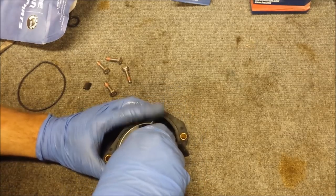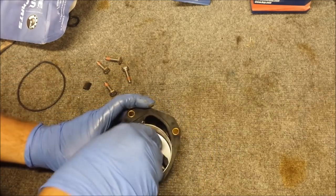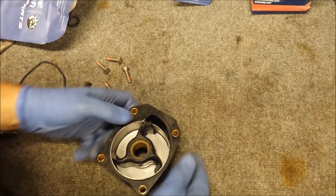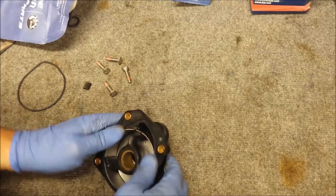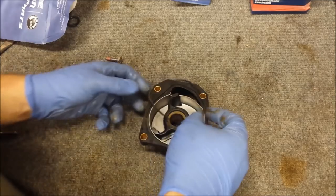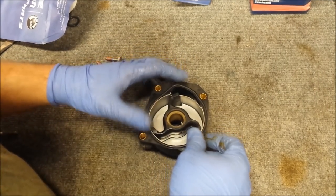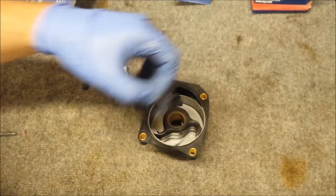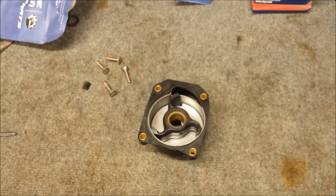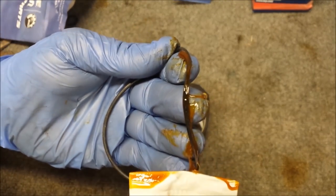This is not easy, by the way. And we got our seal here. I'm going to put some Gasket Sealant M along this seal to hold it in place, and then it should seal when we slide it down. Now, because of the condition of our bottle we won't be seeing much of this, but I will be doing it. This stuff dries fast, so keep that in mind.